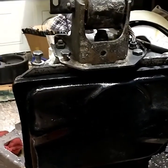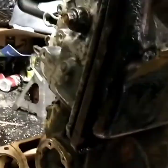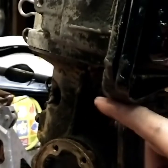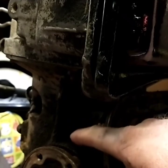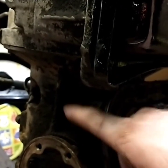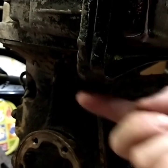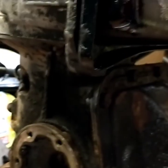I don't know if that's just band material or what. So it's got a new filter in it, it's got a new pan gasket in it. Now the fun thing — we've got to separate the two housings, because the main thing I'm worried about is there are two seals in here that separate the gearbox oil for the diff and the transmission fluid.